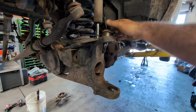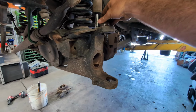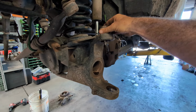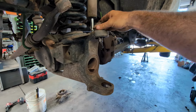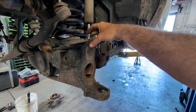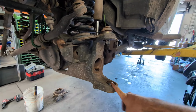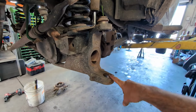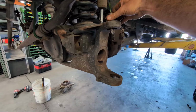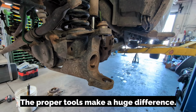We got ball joints out on the driver's side. They went pretty easy with that super nice press that he has. If you only have the cheaper one, like the Harbor Freight one or the one I'm going to link in the description, you may need to tap around here. You might need to put some heat. Mike was saying that one time, literally one ball joint took him 3 hours to get out. So far, we got 3 of them out here in probably 10 minutes. We're working on the last one.